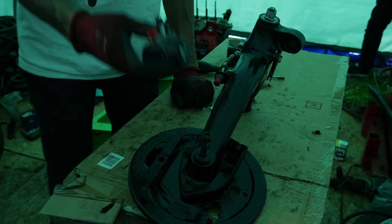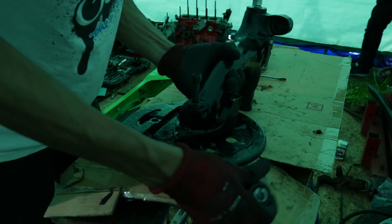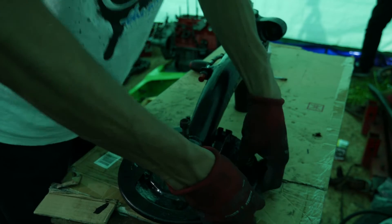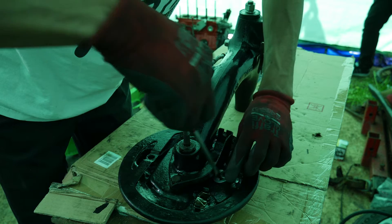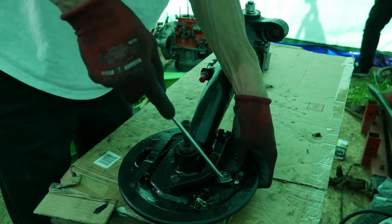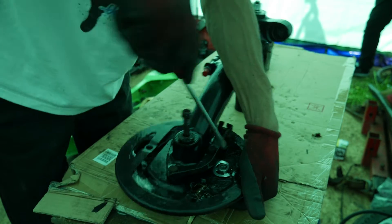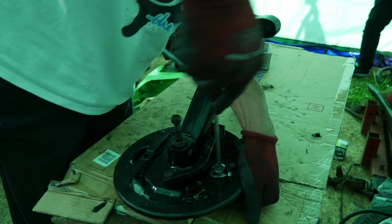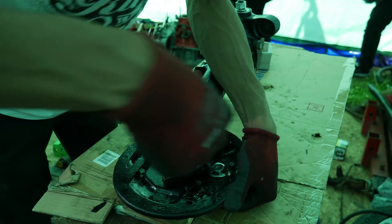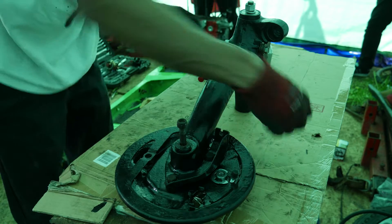First I'm going to try and fit the new wheel cylinder, which is normally the hardest part, though easy because of that little circlip on the back. I'll try and navigate it in, and once you've got all three sides over, you just want to try and push the little clip into the groove — it's the most awkward job on it. Right, that's that in.